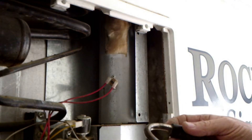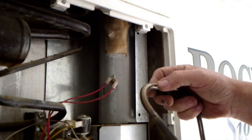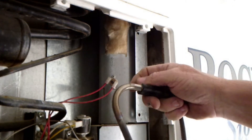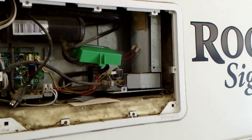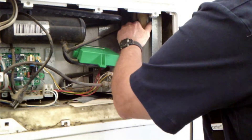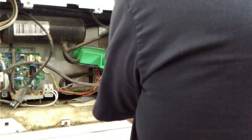There we have our heating element. We want to make sure we get the same size heating element — there are wattages and stuff on it. I'm going to get my glasses so I can read that and go get — hopefully I've got a heating element on the truck — and get this thing done. I closed that garage door; that actually should help with that road noise a lot. There's a slit in that insulation — you can reach up there and feel that pipe that this thing slides in. Feed it up through there.